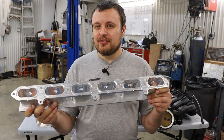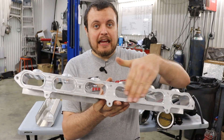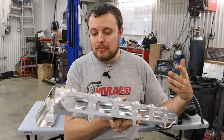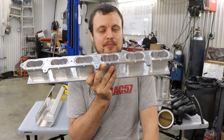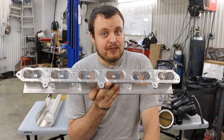The first part of any intake manifold is something that is kind of overlooked, and that is the actual flange that bolts to the engine. Obviously you've got to be able to bolt the thing up — bolt holes have to be in the right location, ports have to be in the right location — but getting this to be very accurate and precise is very important.